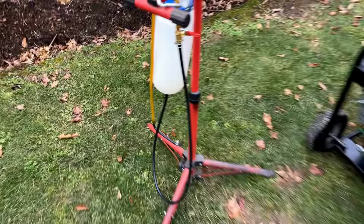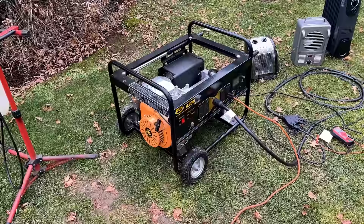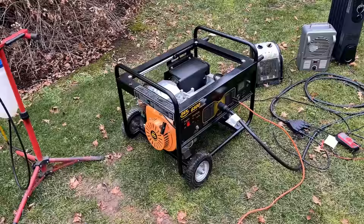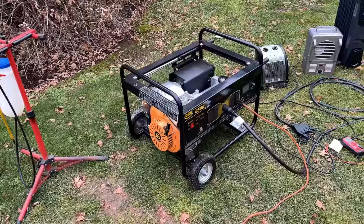Ran out of gas, but that's okay. I've got what I needed. Starting it, even when the engine's been warmed up, is no easier. It's hard to start, and it is popping out of the carburetor. So at this point, I'm leaning away from the valves as being the issue. I know leak down is minimal, the compression is good, and the valves are adjusted perfectly. So I don't think that's it. Really, the only other thing that can cause this is spark.